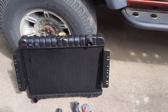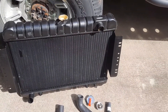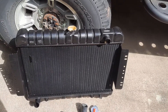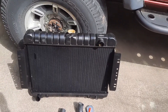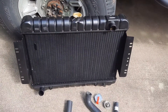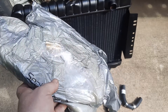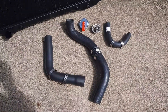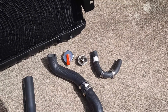Here's what we're going to be installing today — the new BJ's Off-Road Radiator for the AMC V8. One thing to make sure of is on the threads in the bottom ports for the transmission cooler: stripped threads void the warranty, so be very careful. When you receive the radiator, inside the box will be a big green sticker saying an installation kit is included in the bottom right corner. A lot of times people contact us because they can't find it — it's these little brass fittings, typically on the bottom of the spray insulation pack. We're also going to be installing the bypass hose, the upper radiator hose, the lower radiator hose, the Robert Shaw thermostat, and the new safety style radiator cap.